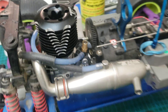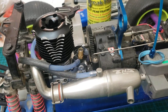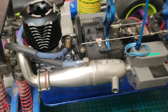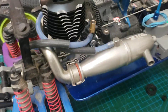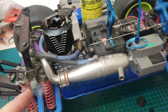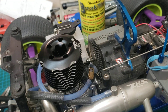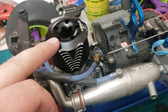I did mention in the past that with 3.3s — I've talked trash about them and I always will — but when you do these engines, the Losi 3.4 carburetor is one of the best upgrades, or the OS 11K if you can find one. Decent exhaust. Don't follow the Traxxas break-in method, don't run the Traxxas plug — run an OS LC3. Decent pipe, decent carb, decent fuel. I don't use Traxxas fuel at all; it's garbage. Use a good 20 or 30 percent with around 8 to 12 percent oil. When you do the Adam Drake break-in method, that's what you want to run with on these.